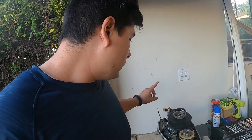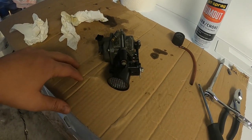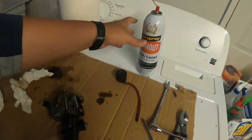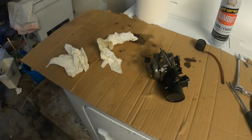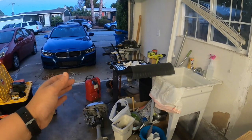I'm also going to replace all the fuel lines — they were a little stiff and I should probably get better ones, but all I have are generic from the store. I'm going to clean the carb, and I don't have a new spark plug otherwise I'd put one in. I'm going to change the oil and the gear oil. I'm also going to put a couple tablespoons of oil into the cylinder head through the spark plug hole. We took everything apart and cleaned it all out with some carb cleaner, so now the carb should run fine. Next thing is to change the oil and the gear oil — they were overdue for a change anyway.